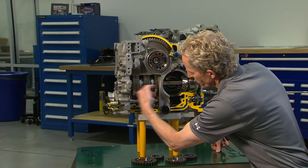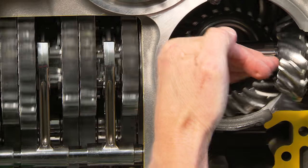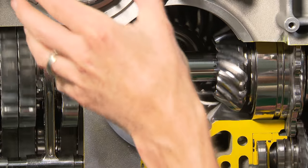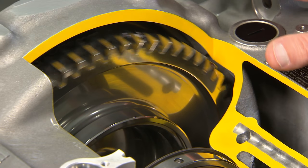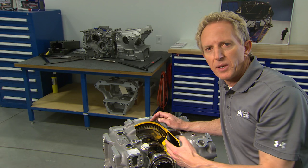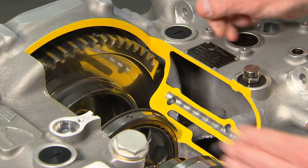Once you have established your gear ratio, this is now going to be an engine orientation. It goes through a bevel gear set that now turns it 90 degrees to axle orientation. That is done through what's known as the final drive. There are seven different ratios you can choose for the final drive, and this is set up in speedway configuration, meaning that the two axles are locked together.